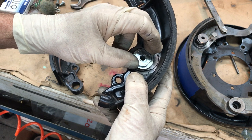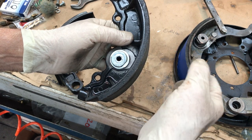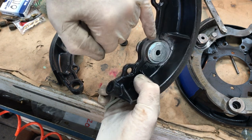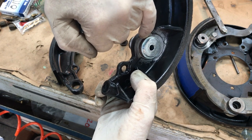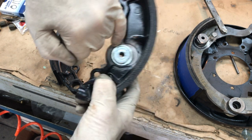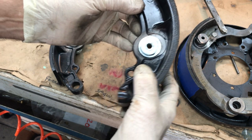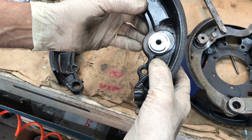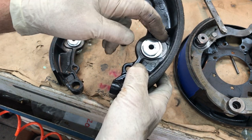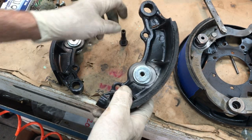These friction discs are designed to resist tiny incremental movements, not large ones. If you use a big pry bar to force a shoe a great distance, you have a good chance of splitting the friction disc — and that's one of many ways they fail. Sometimes they just break on their own. When that happens, the shoe fully retracts against the self-adjuster, your pedal goes to the floor on the first pump, and the second pump gives a firm pedal because the shoe is already extended. One downside: if it's on the back shoe, you can't see it.